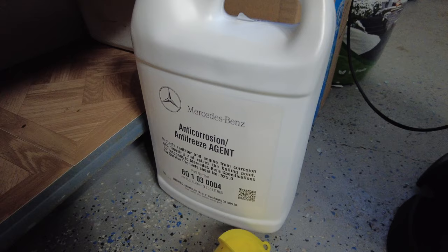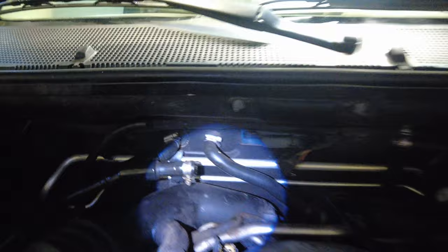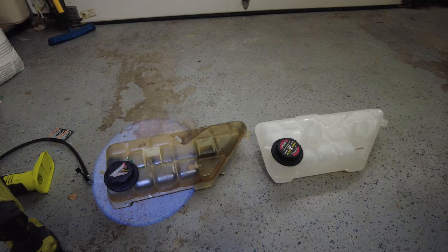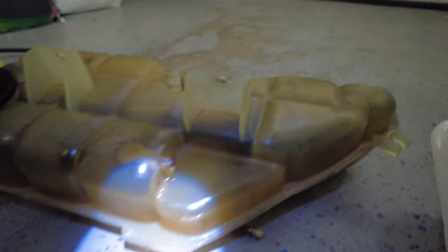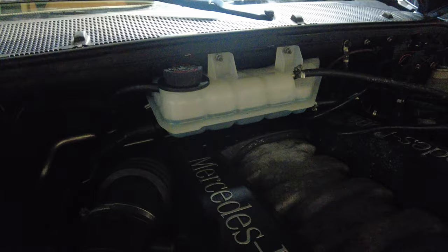I've also got the Mercedes blue antifreeze and I've gotten the old reservoir out — took me maybe 5 to 10 minutes. There are hose clamps you've got to loosen up with a flat head, about three of them, and then there are two 10 millimeter bolts up top — very simple. As you can see, that nub on the old one has physically cracked and broken off from the plastic, and the metal or copper tube was stuck in the coolant hose. On the replacement, the copper bit is encased in plastic as it should be. We now have the new coolant reservoir in with the new coolant, and the rest of the spark plugs are now in.